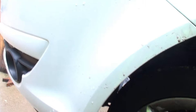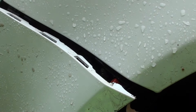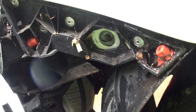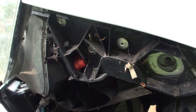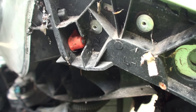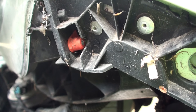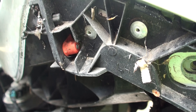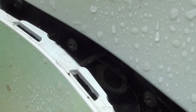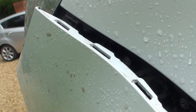Those two T15 bolts are now removed. You can see the lower valance part of the lower wing - grab hold of it and pull it away. Now with the panel pulled away, look towards the front and you'll see a red stopper. That's what we need to remove - it looks like an expanding plug, so you just need to loosen the bolt to allow that rubber plug to relax so it's not distended and should pull through the holes. I'll go in from the front with a long socket and loosen off that bolt.